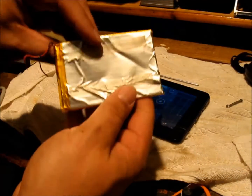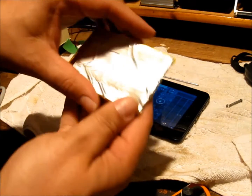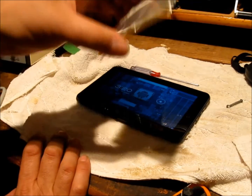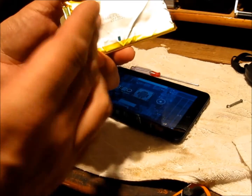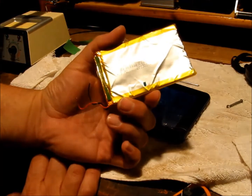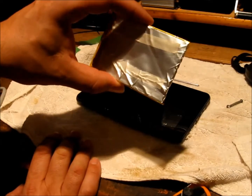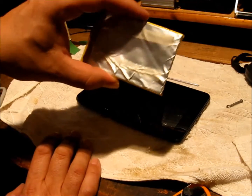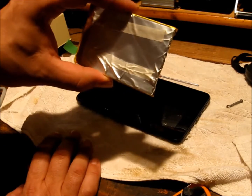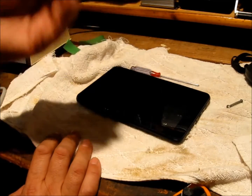We really need to treat these batteries with a great deal of respect. Lithium polymer are excellent — they're flexible and have high energy density for their size. You probably get about five or six hundred charge cycles out of the battery. But you can't puncture them because that could cause them to rupture and explode. You also need to dispose of them thoughtfully — you can't just chuck them in the bin and send them to landfill. Find an appropriate disposal point; probably a store that sells mobile phones or laptops will have a bin out the front specifically for lithium cell batteries. Treat them with respect, and when you finish with them, dispose of them thoughtfully. It's in everyone's interest.